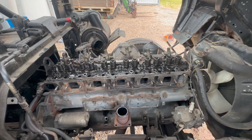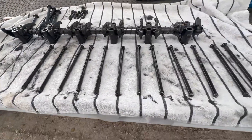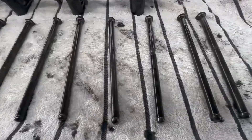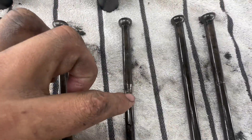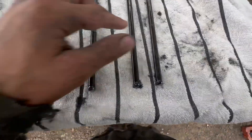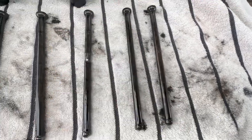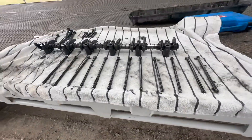Pulled the rocker gears off, the manifold, all the rocker arms off, the rocker assembly. And these are the pushrods. There's one here — this could be an issue. There's a massive groove worn in the shaft of it, so for some reason it's been hitting something. There's a little bit of marking on this one too. Once we pull the head off, I suppose we'll be able to determine what was going on with that.